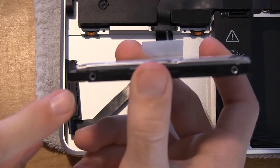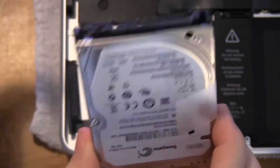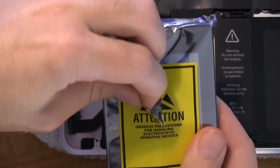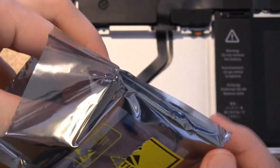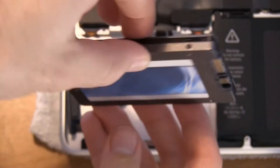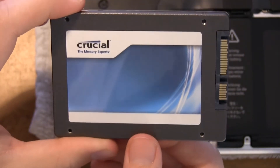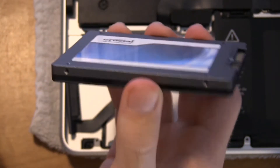I've removed the four mounting screws from the old drive. The next step is to unbox the solid-state drive. It says caution — make sure you use anti-static. You definitely don't want to ruin a drive this expensive. Solid-state has gotten cheaper, but not as cheap as hard drives yet. Here's the Crucial drive — it had pretty good reviews. I'll leave a link in the description below. It looks just like the hard disk drive, just a little lighter, with the same SATA connector and the same mounting holes, which we'll use to put those four pegs back in.